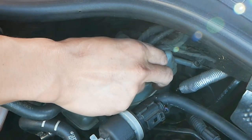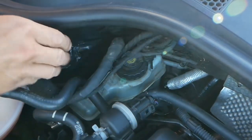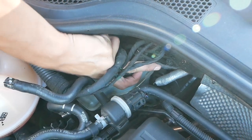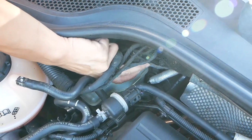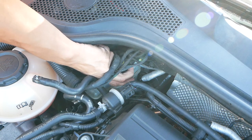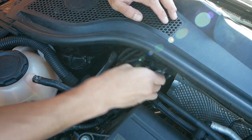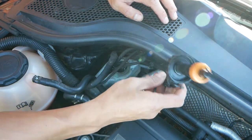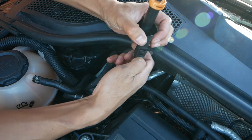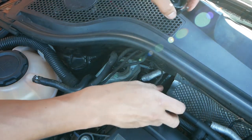We're going to start in nice and close to the area that the master cylinder is in on a right-hand drive vehicle. As you can see here, it is quite a tight fit and I'm having a hard time trying to undo the cap, but it's just a matter of getting a good grip and unscrewing it all the way. Once the cap's off, you're able to undo the sensor plug there. Best tip that I ever learned is to pull on the little tab, but then push the plug towards itself and then pull to release it.